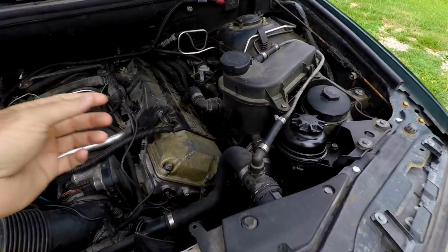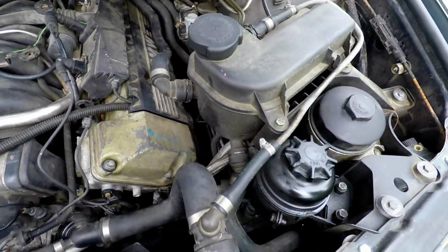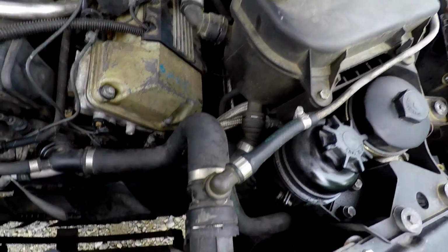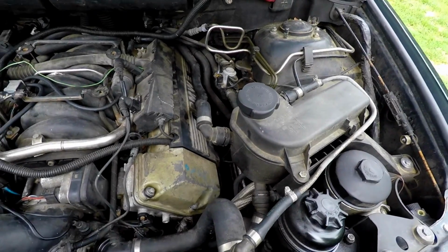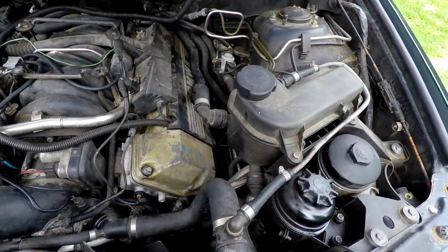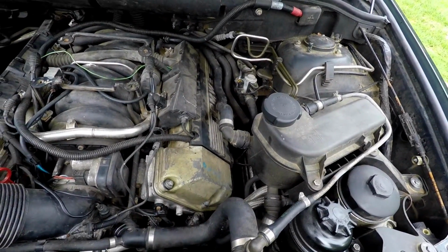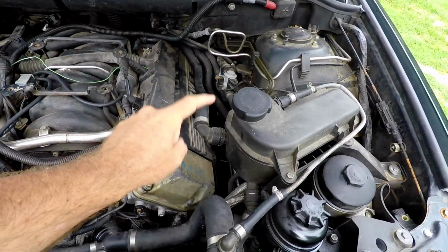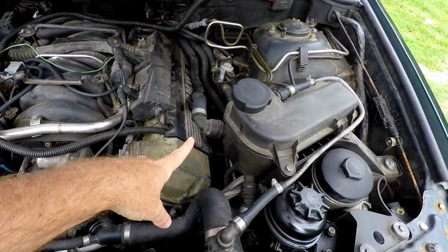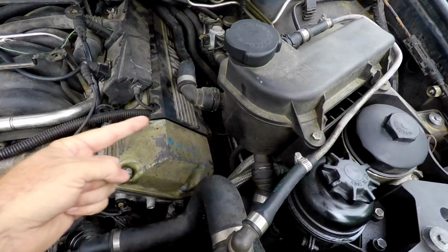And the main thing is going to be the snap lock coolant lines. From a distance, they look fine. You know, they haven't been dripping or nothing. Everything looks great. Damn horsefly on me. But I know these X5s real well, and I know that looks can be deceiving. If nobody's replaced these hoses, or at least the O-rings inside of them, they're going to leak. And I'm going to show you right now why.